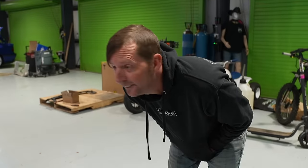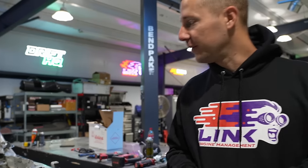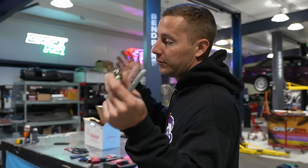There's a nozzle here and here — I drilled those holes yesterday and got them mounted. That side ended up being like four layers of metal, so I had to grind it down so the bulkhead could actually thread in. One nozzle will spray on your fuel system, which can potentially catch fire, and then one on the hot side where all your turbo stuff is, in case a piece of tire or something lands in there and it flashes over.